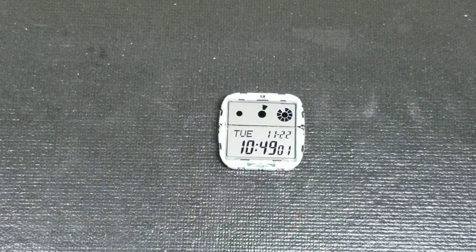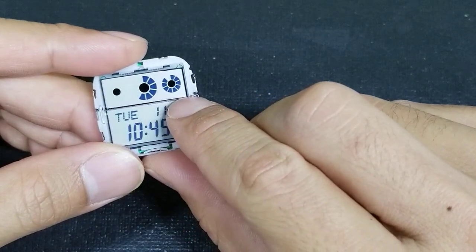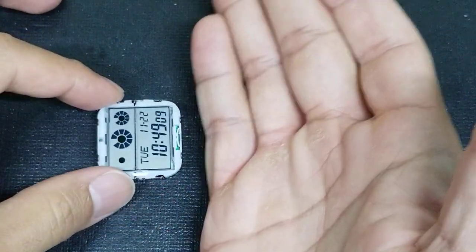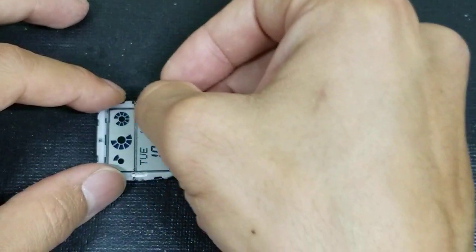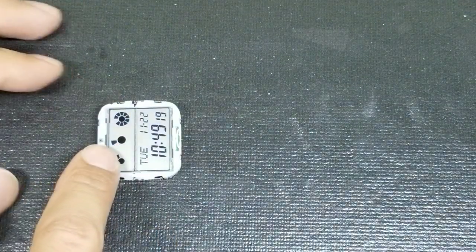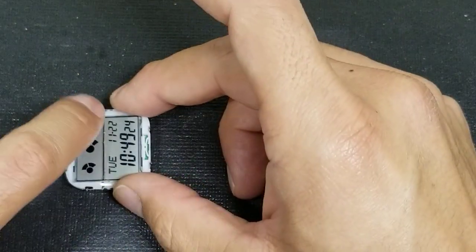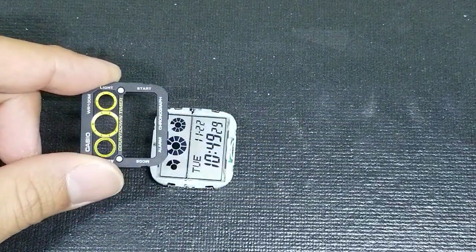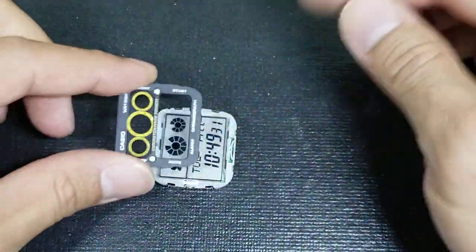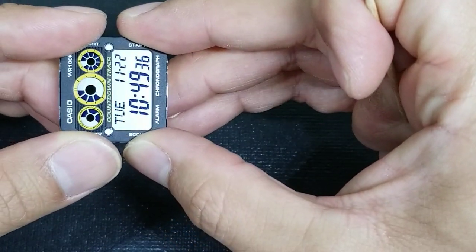All right, so we are on to part 4 now. We've already made our score line here on the display. The purpose for that is that after we loosen the glue off of that polarized filter and peel it up, there's a nice clean line which that filter will break on. That way we keep the top polarized filter on while easily removing the bottom polarized filter. You can see our line there is going to correspond with this line here on the masking, so that when we put that on, it'll hide that cut in the glass.